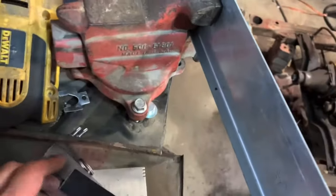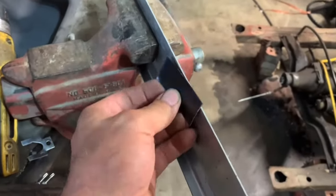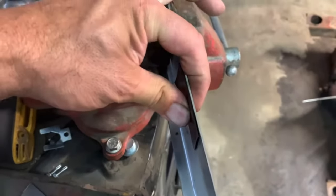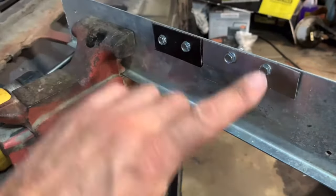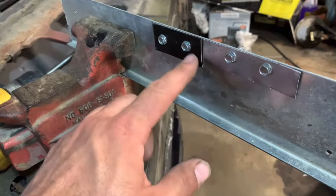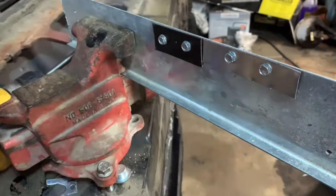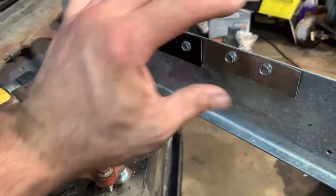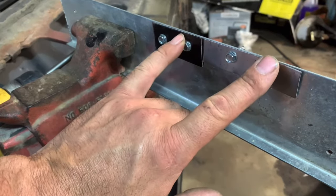First off, just go ahead and get your piece laid into place and clamped as if you're actually building the car. So let's just say that was the rocker panel — take your normal vice grips or clamps and go ahead and clamp that into place. So what I've done — pretend this is the outer, inner, and say this is the floor pan. You're going to get everything clamped with the vice grips, throw your screws in there. Now I'm going to take every other screw out so it keeps things in place while you do your spot welding. I'm going to pop these two out and drill them out.